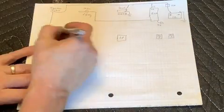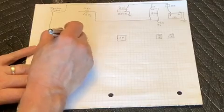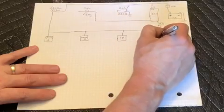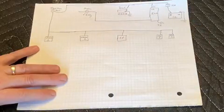If you're using a mechanical fan, you won't have those at all. You could use a single fan and only use one of them, but that's simply just to show that the ECU, whether originally pinned for it or not, can control up to 2 electric fans via relays.